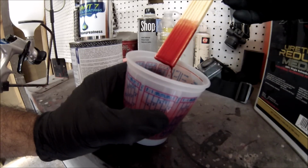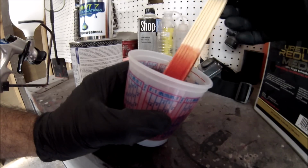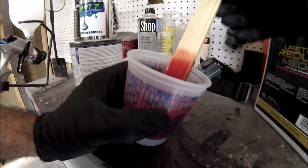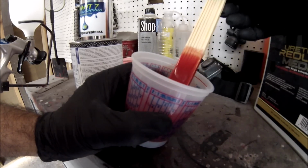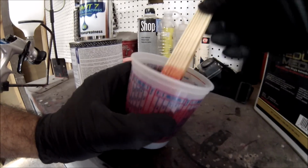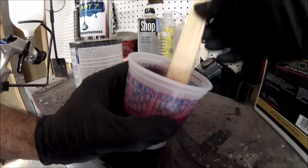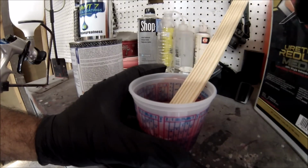So when I start shooting the first pass, it's gonna cover it real quick, and that's not good either, because you need to cover it in layers. You can't go in the first pass and have it covered. It's not gonna work that way. When you're doing a full car, you need coverage in at least 2 to 3 coats. Okay, so this is perfect. This is the way I check. So it's ready. Let me pour it in the gun, start shooting it.